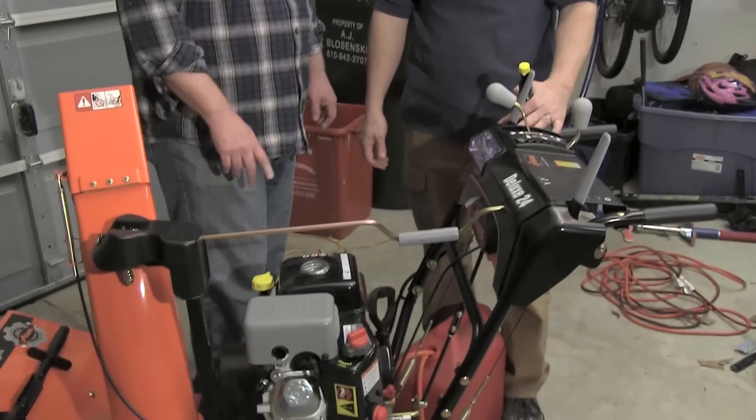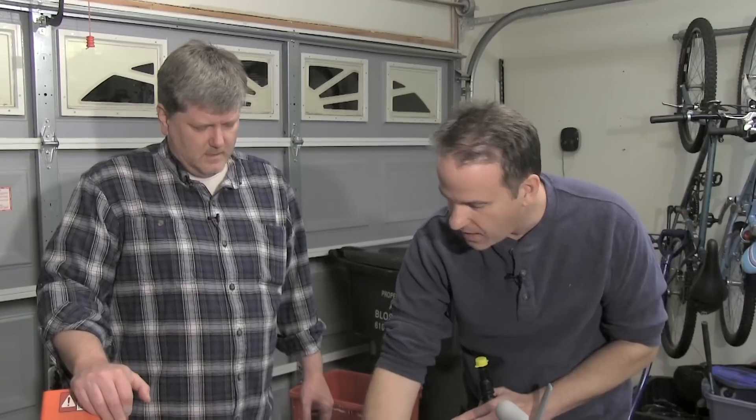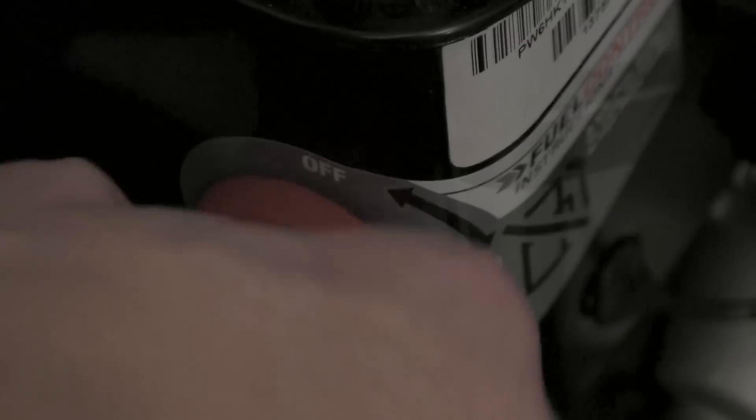In two minutes you're going to be fine. That's your intermediary option — best if you only have a little bit of fuel in the tank or maybe it's a quarter full. That way you're diluting that stale gas come next winter. Just to be clear: the first option is to use stabilized fuel in the tank on your last run of the season so it's throughout the entire system including the carburetor. The second option is to pump out as much fuel as you can and then run it dry until it just shuts off. The third option, best if you don't have a lot of fuel in there, is to run it and shut off the fuel line — if your machine has a shutoff like this one does — and then let it run until it's burned off whatever's left in the carburetor and the fuel line.